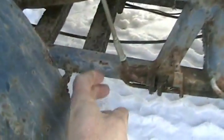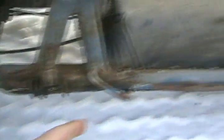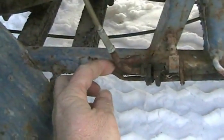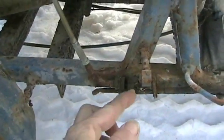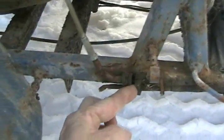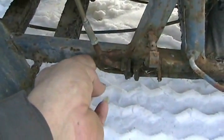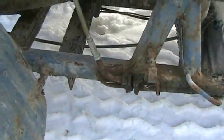There's the throttle cable, and I even had one other little feature no one else had. When you started it — that throttle cable connected to a steel rod that went to the pedal — to make it run so it wouldn't stall when you started it, you push this thing down; that would actuate this little thing a little bit and put it on fast idle. Then you could, while you were driving, reach over and set it back to normal idle speed, or anything in between if you wanted to. I can't believe that still works.